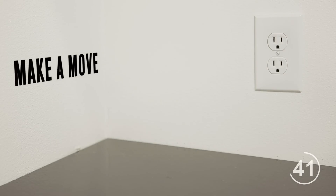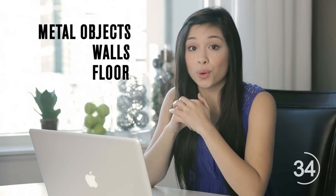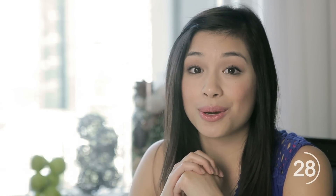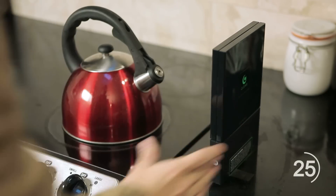The problem might just be that your router is tucked away in an entertainment center or other areas of the house that don't offer much range. Everything from metal objects to walls to floors can interfere with a Wi-Fi signal, reducing your bars. Find a spot away from metal objects in a central location of the home. Get creative — sometimes a bathroom or kitchen is the perfect place.